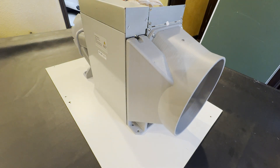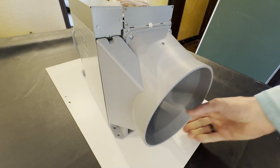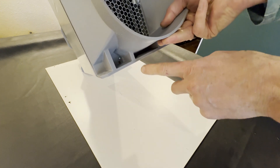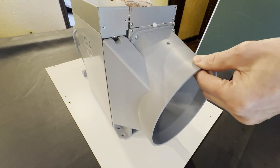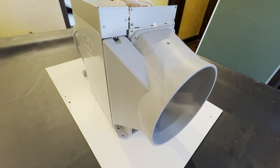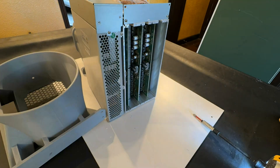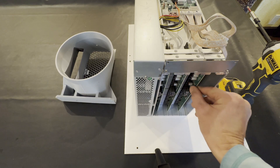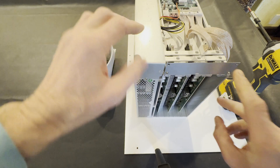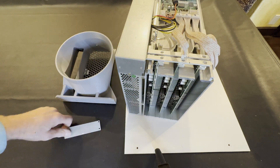We're going to take a hash board from this side. If you remember, we left the holes there — we drilled a hole at the bottom so we can remove all four screws at the corners and take the whole heatsink out. Now that we've disconnected it, we get the full board. We need to remove this plate and then remove the heatsink.